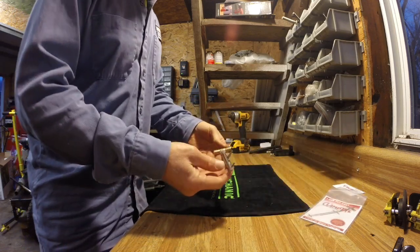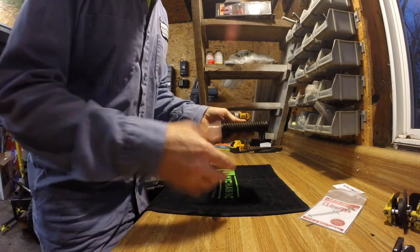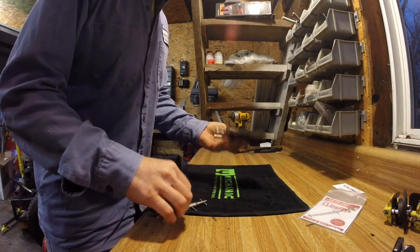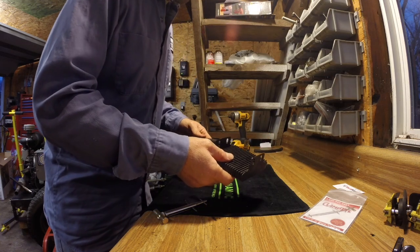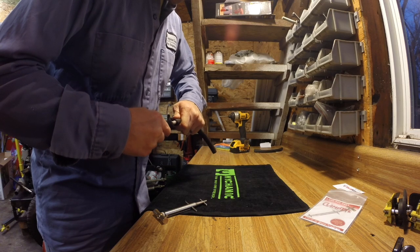I found another tool online that I liked — if you follow me on Instagram you already know what this is. It's called a Clamp Tight, and it's essentially a wire hose clamp tool. You take stainless steel wire, wrap it around the hose, and this tool tightens it up and you bend it over to crimp it off. This little tool here — and this is one of my oil coolers for one of my motors — I have to put a new one on this mower beside me, so we're going to use this tool and crimp these wires off. We'll put the hose on there first.